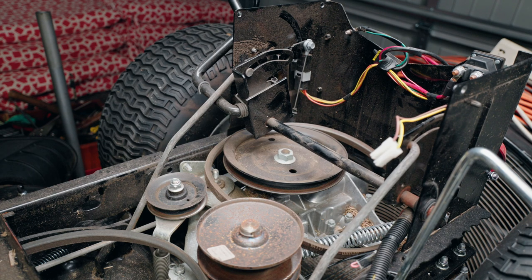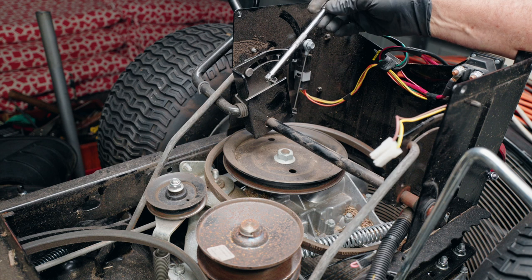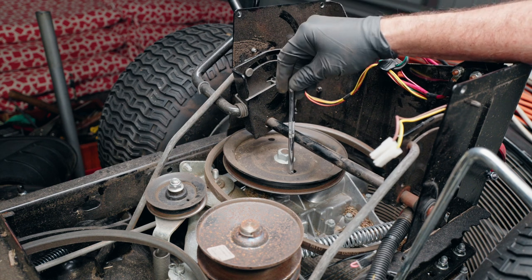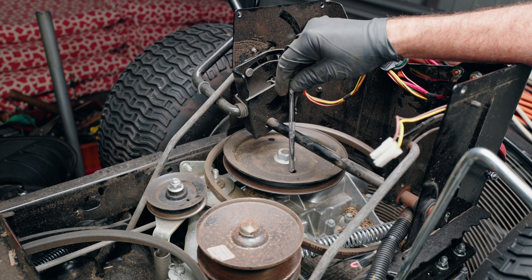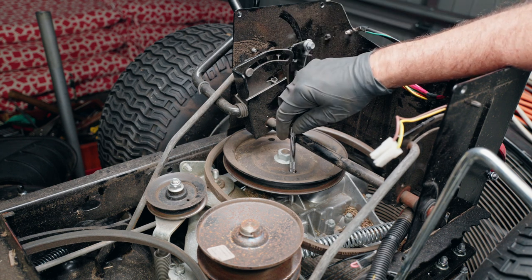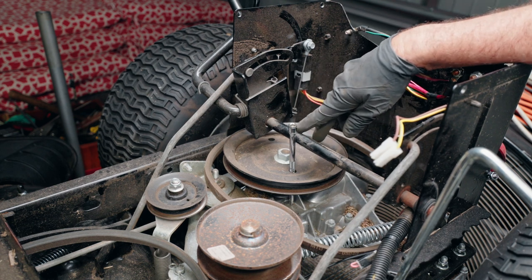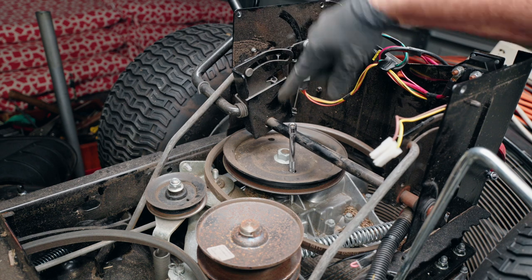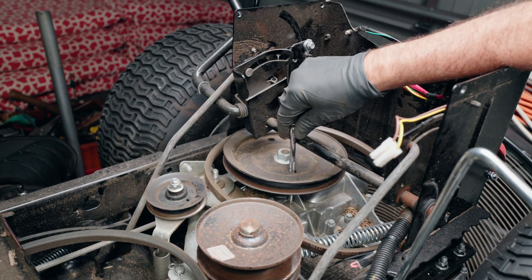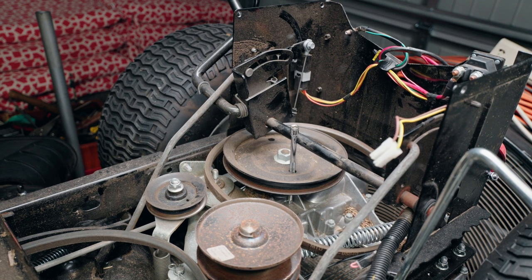You'll want to reach through the battery compartment right here. I'm using a quarter-inch extension because it's pretty stiff metal. You've got these holes in here so you can lock this pulley up — stick it right down through here and wedge it between this bar, which they put right in the way of a direct line with a socket. There's a little ear on the transmission down there that I'm lodged against, so you should be able to lock it up pretty good like that.